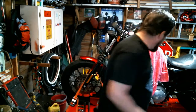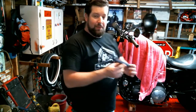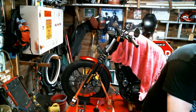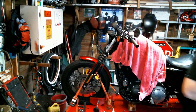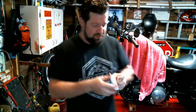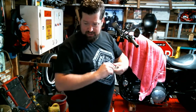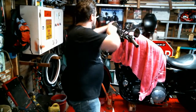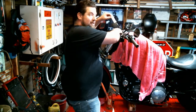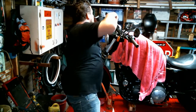From there, we took these old tubes out — these are preload spacers, setting the tension and ride height on the spring. Progressive sends two new tubes to cut up ourselves; they're white pieces of PVC. The instructions give you lengths to set them per your spring rate and per your bike. These were three-quarter inch tubes. If you screw it up, go to the hardware store and buy more. Make sure it's nicely deburred on the end. There's supposed to be a washer inside each one — put the washer on top of the spring, then put the spacer in. Washer on top of the spring, spacer in there.